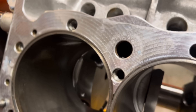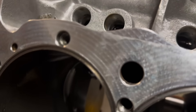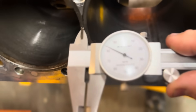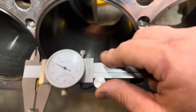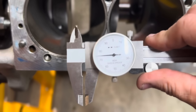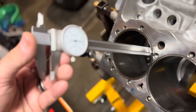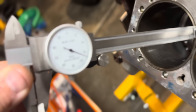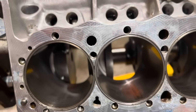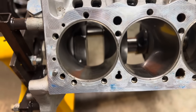Let me see if I can get a good angle on it — it is so hard to see this on camera. But that thing is probably 50 thousandths wide, maybe 60 thousandths. Let's get it down in the groove — these are separated. This groove is about 80 thousandths thick, so it is pretty good thickness. Somewhere in the 80 to 85 range. It's hard to do it and hold the camera. For the depth of it — stick it down in there and push it down — 35 to 40 thousandths deep. So that is the width of the receiver groove, just a lot bigger than an O-ring. And the way it deforms the gasket is crazy, and it really seals really good.